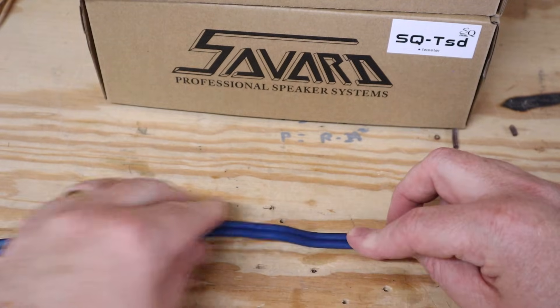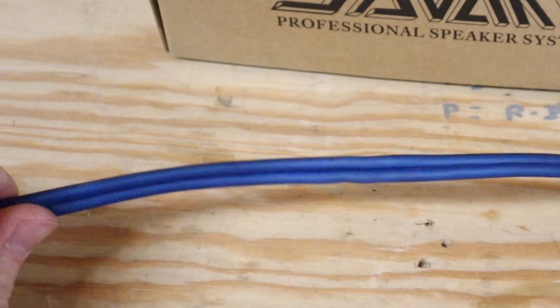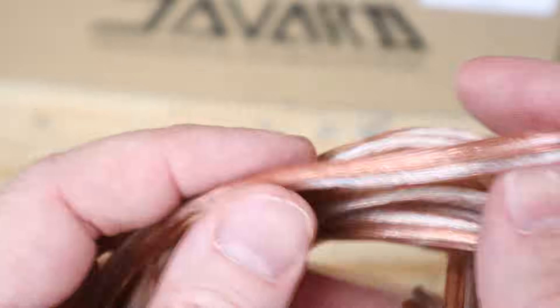You can't use that trick if you've got a sealed box — we'll get to the sealed box in just a second. But before we do that, I want to show you this super easy trick that's going to help you reduce the chances of flipping the polarity on your subwoofers, and that's really simple: pick out a wire that has clear and obvious color coding. I have grown to hate this wire right here — it's good wire, but both of the insulators are the same color, and the only way to tell them apart is to look for this really tiny lettering that's only on one side of the wire. It's difficult to see, especially in low light situations, and you are tempting fate with this wire. This wire here is not any better — it's probably worse. It uses a clear jacket and one side has a stripe that's really hard to see.